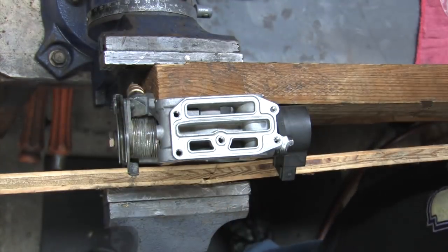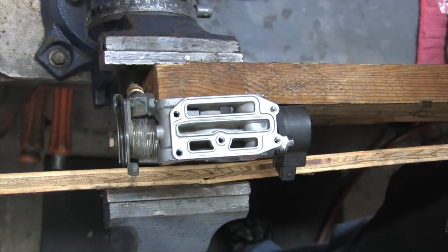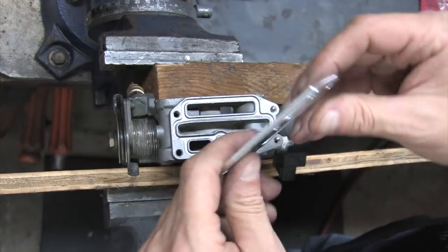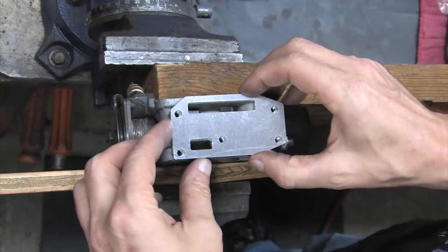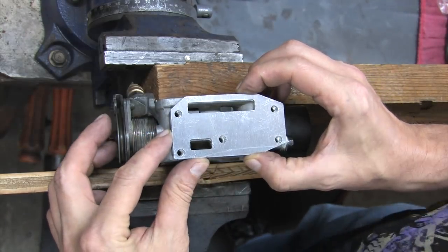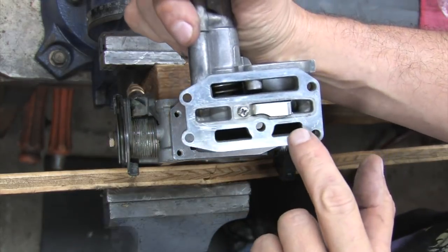I suppose they can go bad, mine never have, but when they do, some people just disable them. There's another group of people who do this because hot coolant heats up the throttle bodies and can raise intake temperatures. Not cool on a race car. There's a few different ways to disable the fast idle air valve, and one of them is to use a block-off plate. Some block-off plates disable the idle speed controller motor, and some don't.